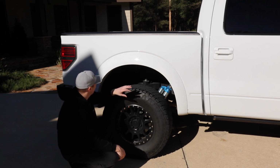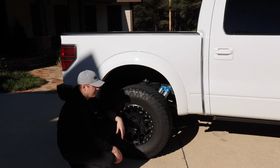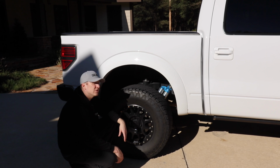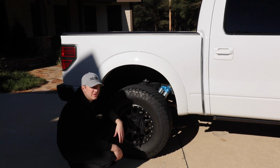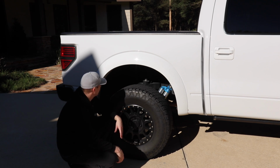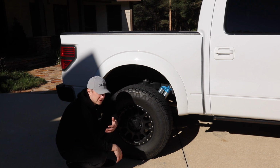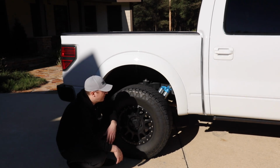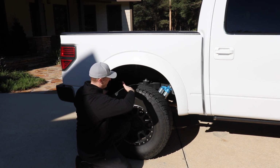But anyway, this truck has the same thing, where we have Line-X in the interior, but this has a stage 2, or I think it's stage 3, RPG rear suspension. The shocks are not upgraded, but the bump stops are, which I think Charles just did because they had it all torn apart, so they weren't all that expensive. But I think it's an RPG bump stop. And then we have a Deaver Plus 3. A Deaver Plus 3 has more sections internally in the leaf spring. The leaf spring runs from here to here and runs up underneath the truck.